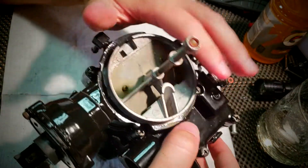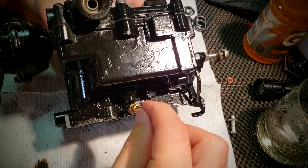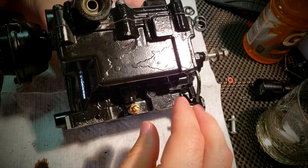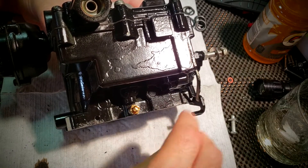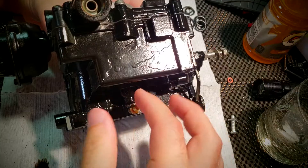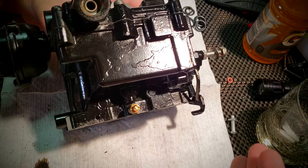The next thing I want to cover is the idle mixture screw, which is down here. We already installed this in the last video. When you put in the new one, I tightened it by hand. Now your threads are corroded and might be hard to turn in, so you can use a screwdriver, but you want to turn it all the way in until it seats — don't go crazy on it because you can damage the seat. Then what you want to do is back it out one and a quarter turns. That's the recommended setting from the manual, but that's something you're going to want to tune on the boat. The correct procedure is actually to tune that with it in the water at operating temperature, and I believe it's even in gear.